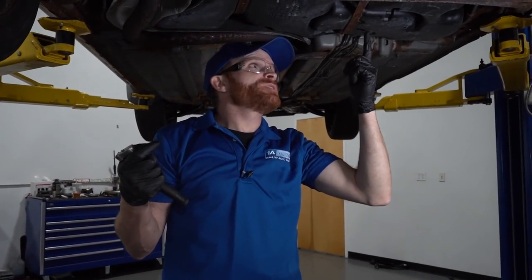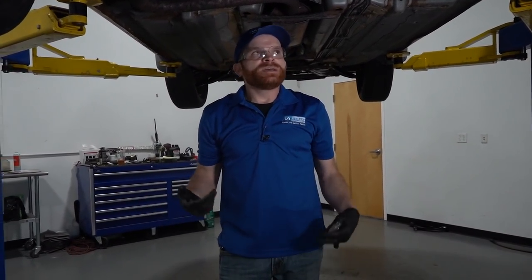Overall, when I'm replacing a brake fluid line like this right here, I like to bleed all the brakes. It really only makes sense to me. If there's an area that fluid can make its way out, there's also a possibility that contaminants could make their way in, in which case it's no good overall. Also, this thing has 66,000 miles on it, which really isn't too much, but it is over 10 years old. Brake fluid generally doesn't last forever, especially DOT 3 or even DOT 4 brake fluid, because that's hygroscopic. Hygroscopic essentially means that it's going to absorb moisture from the air. If you live in a humid environment like we do here, it's very common for moisture to somehow make its way into the braking system, in which case your brake fluid is going to be diminished, it's going to have a lower boiling point, and overall it's going to be kind of unsafe.